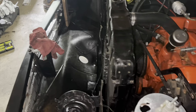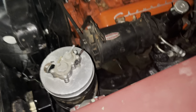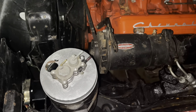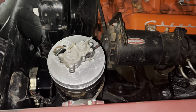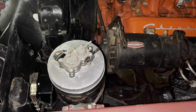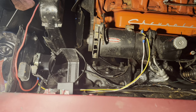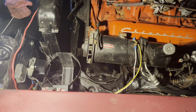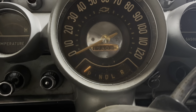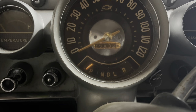I'll probably put the five-gallon can back up here and drain all the brand new gas back out. Now it's time to wire this generator situation. Apparently these things don't have a battery stud — they just have field and armature that go right to the regulator, and the regulator connects to the battery. It would do this through an amp gauge if the car had one. What the heck do I know about generators? Not much, but I know this one's wired now. I do know I have to polarize the regulator thingy. We're definitely charging. The belt squeals now because it's got a load on it — that's a good sign.